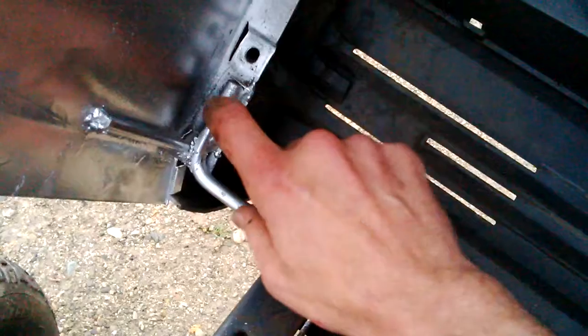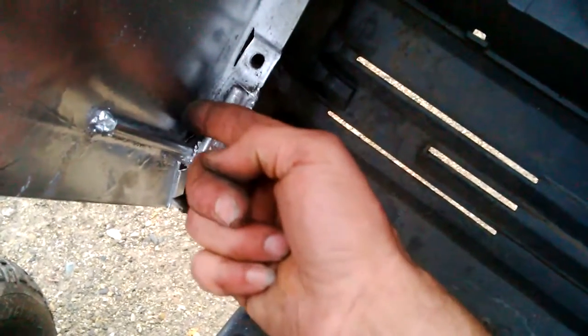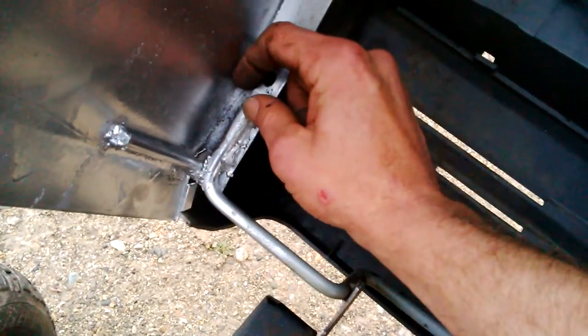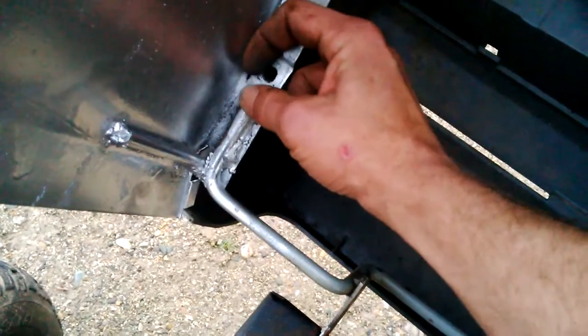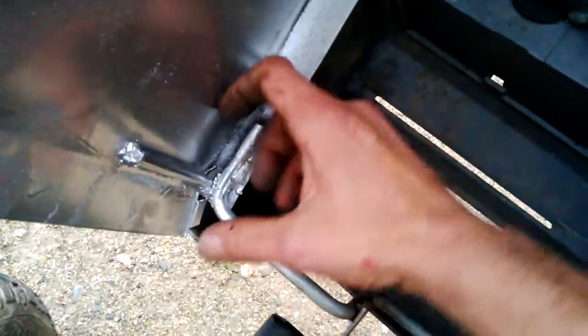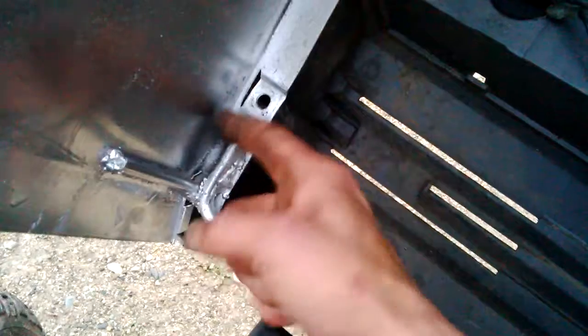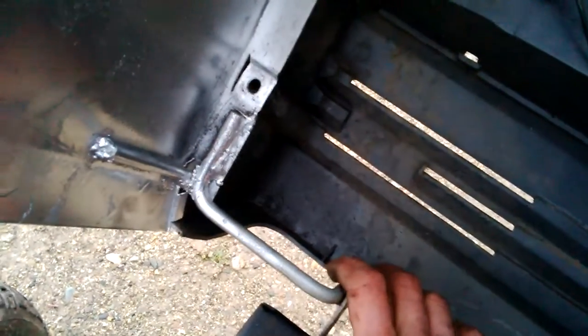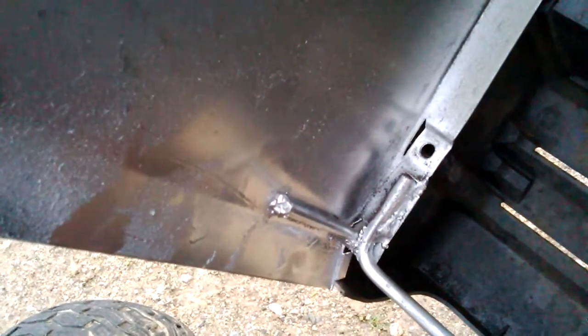So that's why I ran it back here. You could have attached this to a lot more — even just being able to tack it into the corner — if they would have adjusted the hood by an inch narrower, or a half inch each side, so this bar could have actually been in the corner, welded to here and to here. Then you'd have had it made. Anyway, this is the answer I came up with. The hood was silver paint or aluminum, so it's a two-tone hood now. When I painted it, I just took a piece of tape, ran it across, done, and put the grill back on.